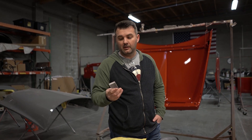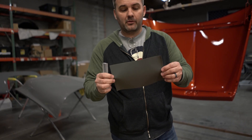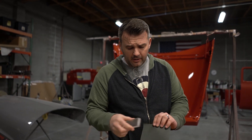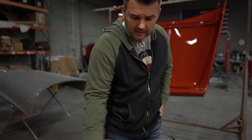If you've put plenty of clear down — and I'm going to say at least three coats, in a lot of instances you probably need about five — we start with an acrylic block and somewhere between 800 to 1000 grit. We'll take some sandpaper like this, it's kind of a wet or dry 3M product, so we get it, we soak it. We have spray bottles, we wrap this around here and then we'll just start cutting in kind of a cross section and getting it to be flat.